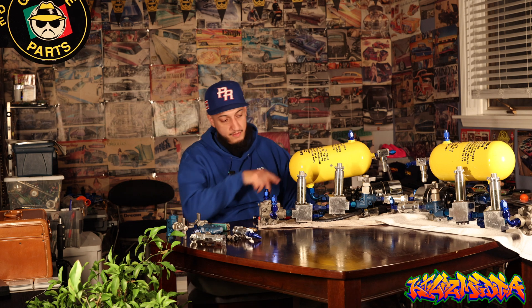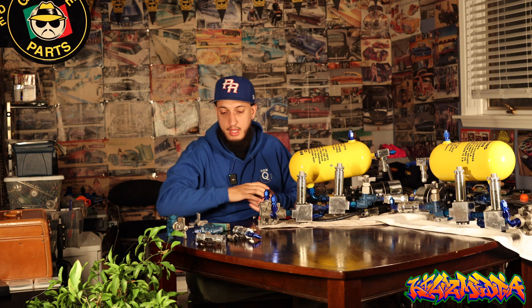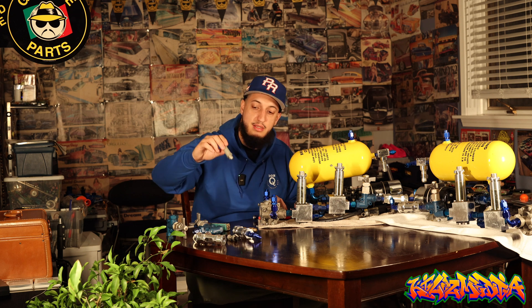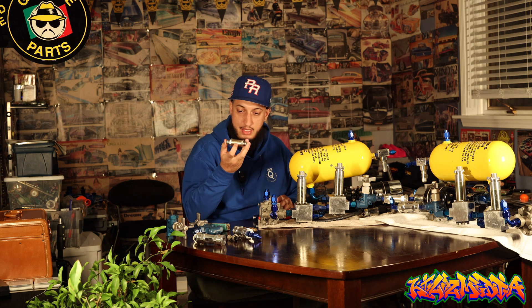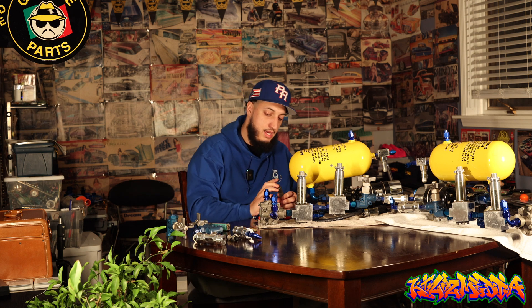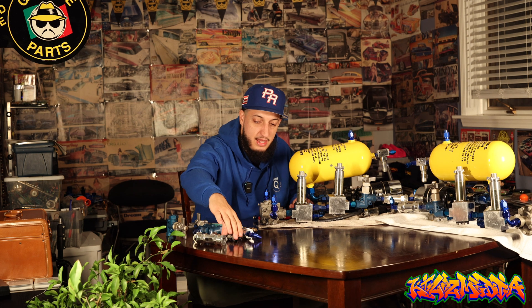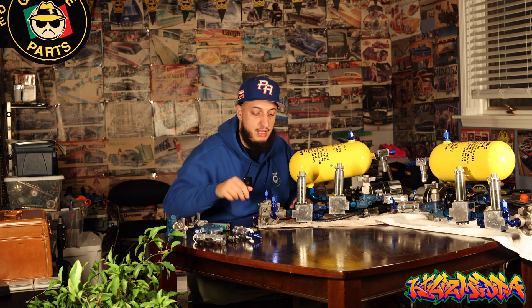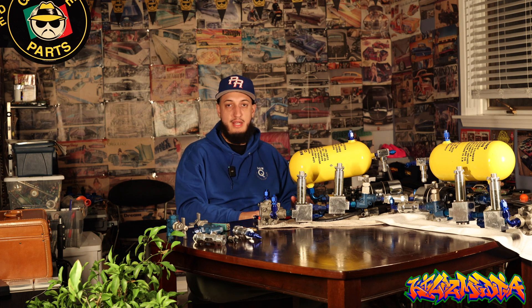My fluid flows through the Parker check valve — Parker check valves are 3,000 PSI steel, made in Cleveland, Ohio. My Parker number eights are from 1959; there's a date on them. I also have a number six dated fourth quarter 1963. Then I have a super rare Adel check valve — you don't see those too much. Adel is known for the squares but they also made motors. They have Adel straights and Adel sidewinders; the sidewinders came out of helicopters.